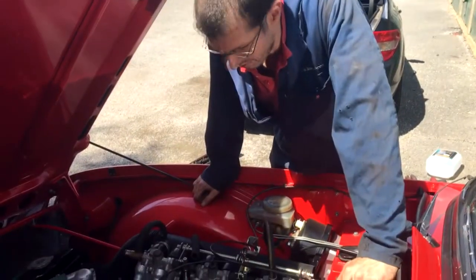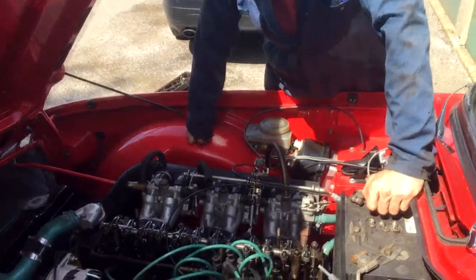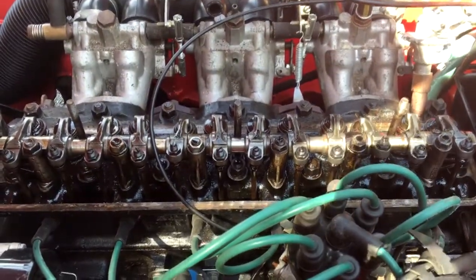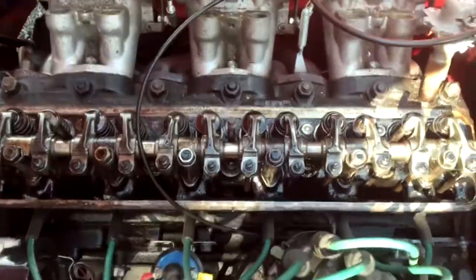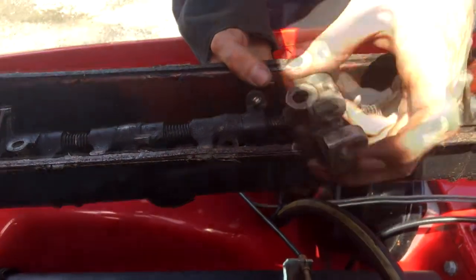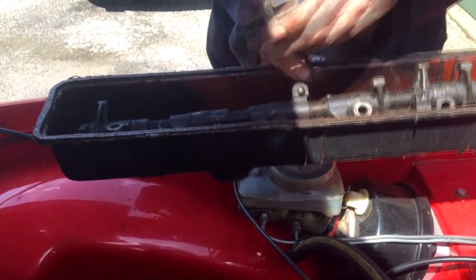Yeah, well, we've got the rocker box off, so let's say 3 easy bolts get it off. And on the rocker shaft, you see in Danny's one, we've uprated it to the Moss rocker shaft, which is a bushed rocker shaft. I'll get the old one over here. We did this a while back on Triumphs. They never actually had bushes in between the rockers. It was just running straight metal to metal. So what we've done, we've upgraded it to a Moss rocker shaft, highly recommended.